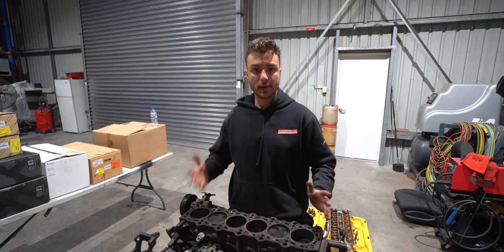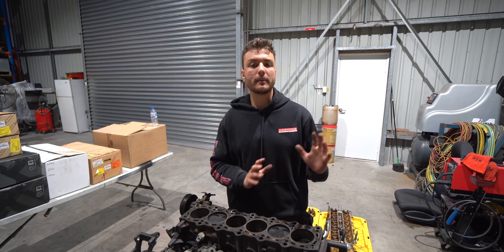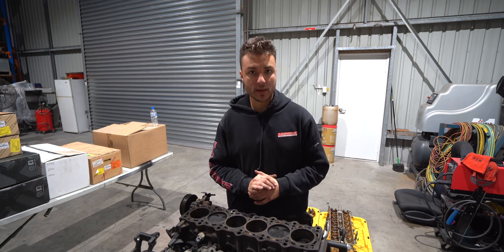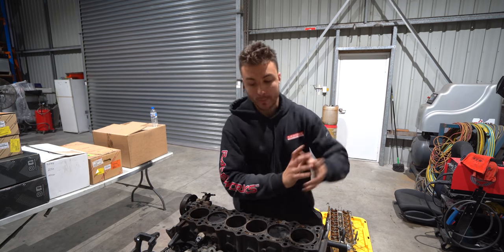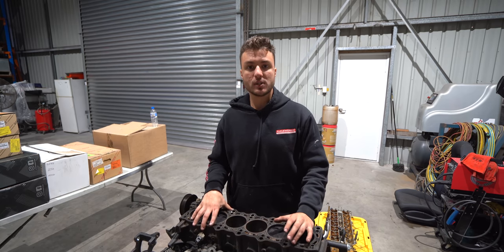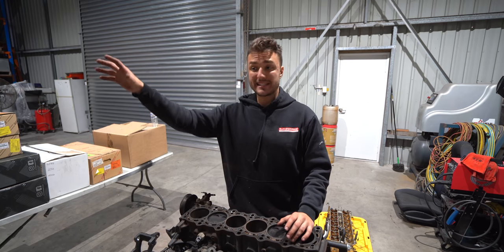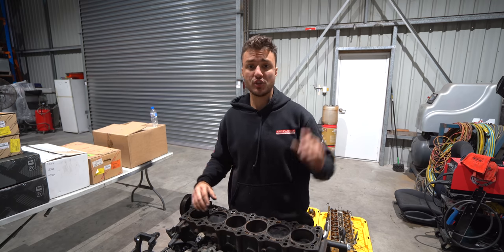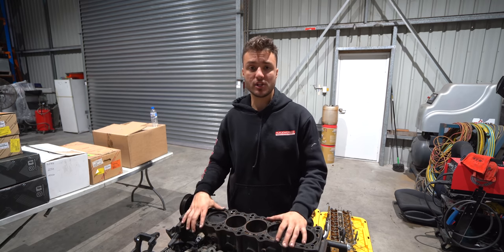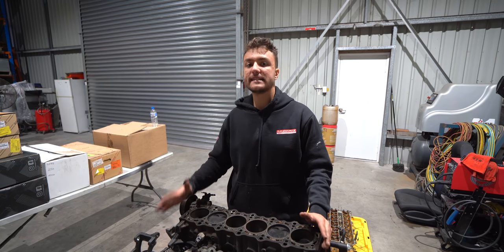Now you're thinking, turbo application, higher compression, probably not an ideal thing. Probably better to stick with the turbo engine, and that's why it's worth more. And that isn't entirely correct, because nowadays we are living in 2021, we have a lot of alcohol-based fuels, we've got ethanol, we've got the best ECUs we've ever had, we've got the best tuners that are able to control these ECUs we have ever had. So having a high compression engine actually isn't a big deal.